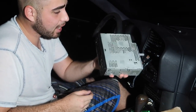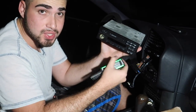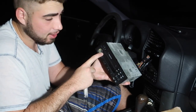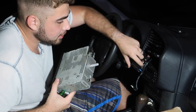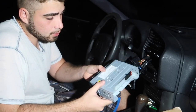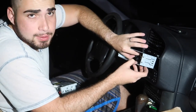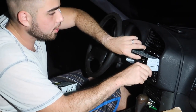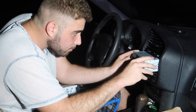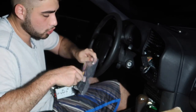Just like that we got the radio out - that was actually kind of a mission. There are two flaps with holes; I put a little allen key in those holes, loosened up both sides, and the whole thing just slid out. That's how you remove the original. It's still beeping - I don't know if this is gonna blow up on me. Anyway, out with the old. Luckily this thing didn't have any aftermarket system so the new one should just go directly plug-and-play. With the new radio, the first thing you want to do is take apart the metal frame and put that frame in first. This is the plug-and-play harness from Race German - it should literally be two plugs and we're good to go.